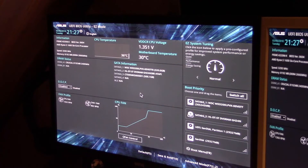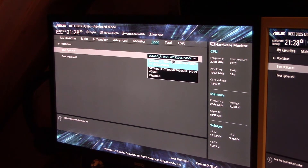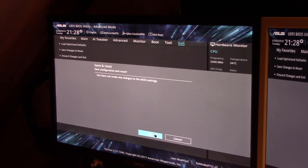Once it has completed, it will shut down the computer. Then you want to boot up the computer and enter the BIOS — do not let it boot up Windows, because then it will just boot from the hard drive. We've just moved everything to our new SSD, and now we want the computer to prioritise that SSD and boot up from it. In the BIOS — which is different in every BIOS, so check your motherboard manual or just Google it — there will be options for adjusting the boot priority queue. Just set your SSD to number one, then save and exit. The computer will reboot and it will now boot from the SSD.